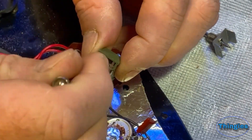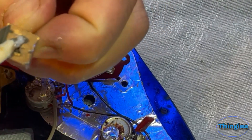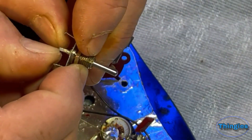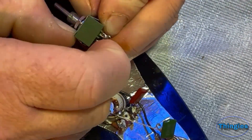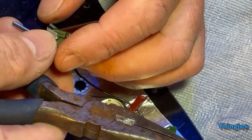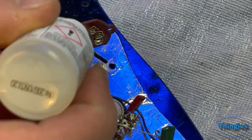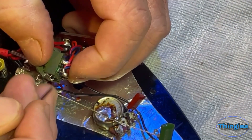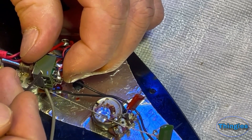A splodge of white grease that I've found in the depths of my drawer not only helps everything keep together but it's also conductive, I believe. I'm pleased the grease is holding all this together because this is fiddly - I've got to line up this minute pin to this even smaller piece of brown plastic that makes the switch rock inside. Just pinched the holding lugs back together again. And yep, I've gone and broken the old and brittle plastic switch. Time to get sticky with some super glue. Nobody's gonna know.